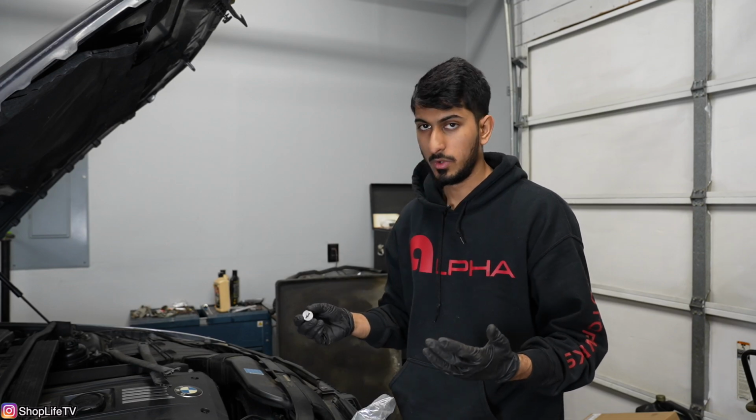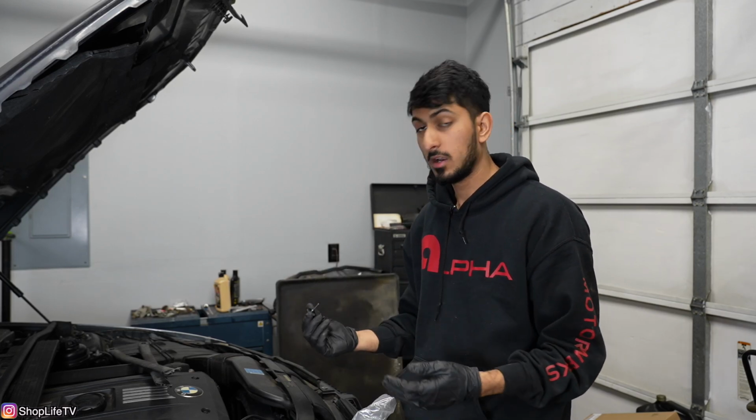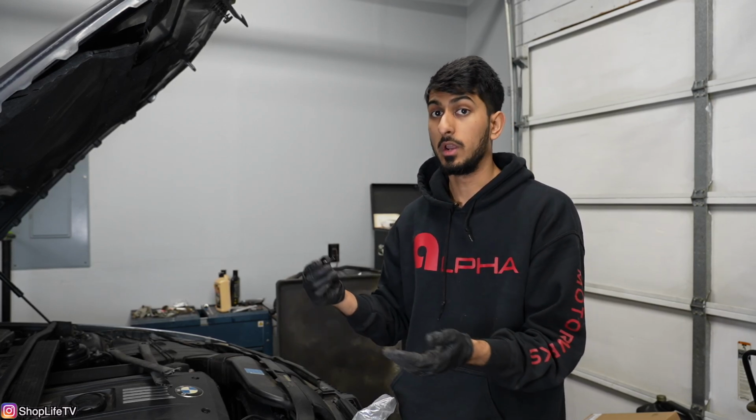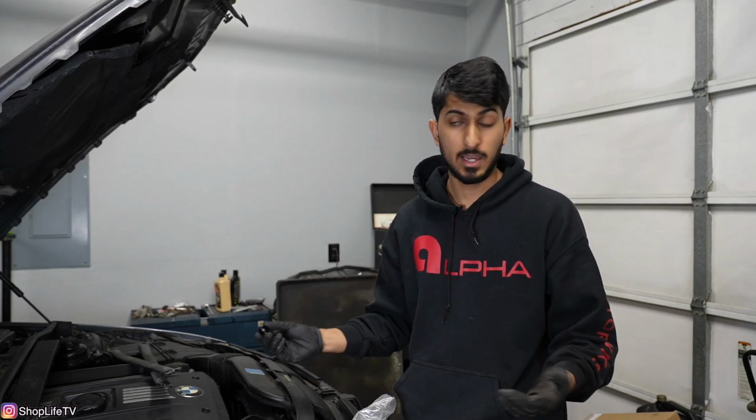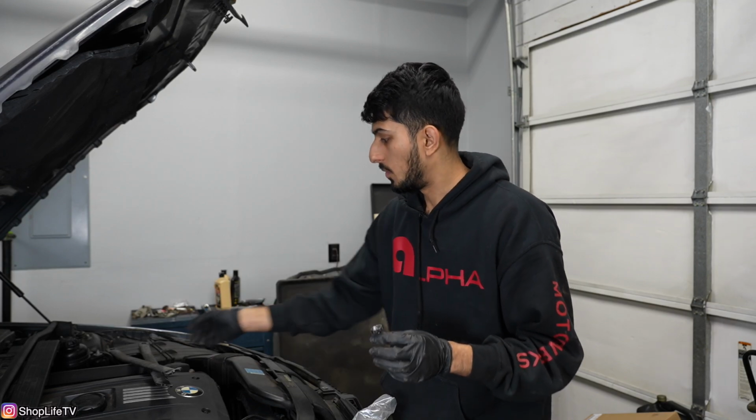So what I would recommend doing first is go fully hard and then dial it back about 7 or 8 clicks and then see how that feels. And from there, you can adjust how soft you want it, or if you want it harder. If you like it like that, you leave it like that. So it's very straightforward, but in the front, we do have an issue with the strut bars.